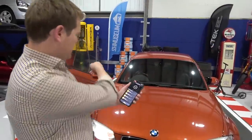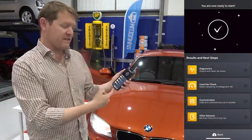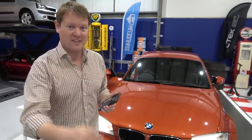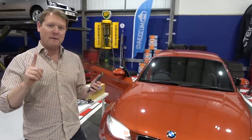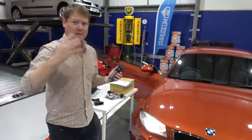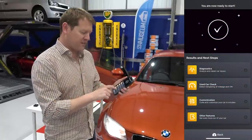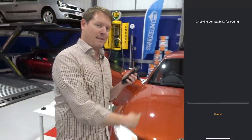Now that it's connected — the OBD plug is inside the car — we've got diagnostics, used car check, customization, and other features. If you have the premium package for an annual license fee, that's where you get access to manufacturer-level diagnostics along with even more coding access to configure things. For example, you can change the lighting of the Angel Eyes on the headlights, change whether the mirrors will fold, set chimes — it depends on the specific car what you have access to. Let's go into the coding and see what coding possibilities we have on the 1M.